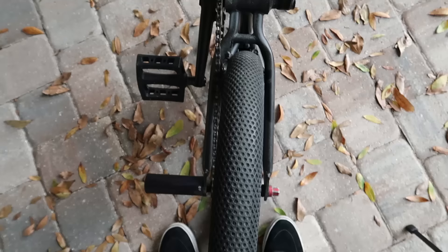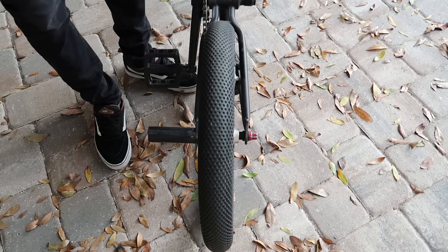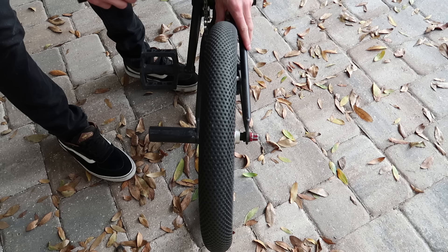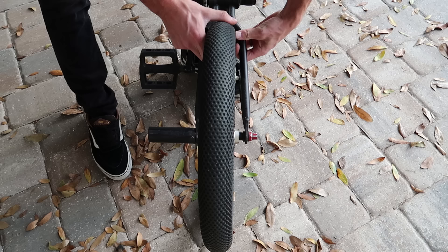Another really common issue is when you're trying to tighten your back wheel and keep your chain tight, but it moves around because when you turn that little nut it goes on the frame and either moves the wheel back or forward. I'm going to show you a little trick for that too. Start with both sides loose, then take your non-drive side, move it over so it's almost touching the frame or as far over as you can while pushing it lightly backwards. Tighten that side, and then while tightening the other side, just push the wheel over to the side and tighten. That way you're working the wheel back. It might take a little fiddling, but the side-to-side method always works and saves a lot of time. So next time your friend has a loose chain, show them how to do it — otherwise you'll be doing it for them every single time like I always do.